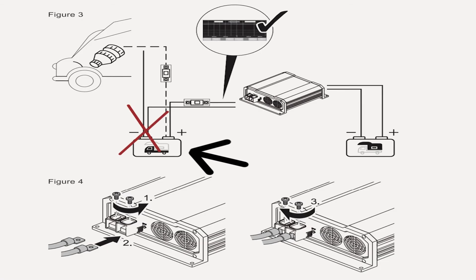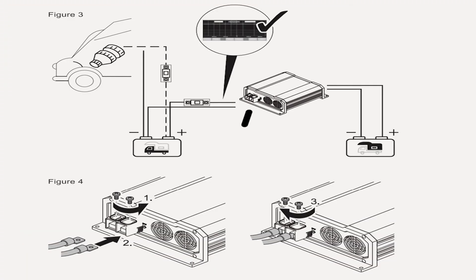To sum up: if you have a green flickering light or a red pulsing light, don't throw your charger away and don't send it to Renergy right away. First, try unscrewing your ground. If you have it grounded somewhere on the car's chassis, unscrew that and screw it back in — or find a different grounding point. You can also undo your D-plus, wherever you have that connected, and put it right to the positive side of the starter battery. Hopefully this gives you a few ideas to try. Good luck fixing your issue.